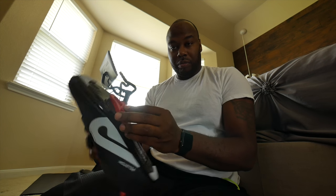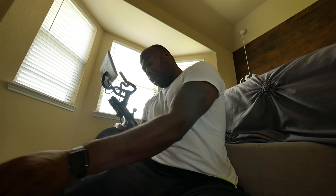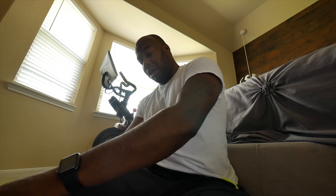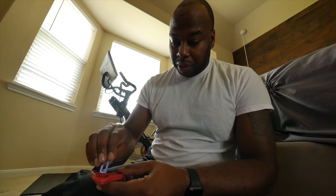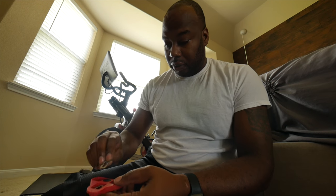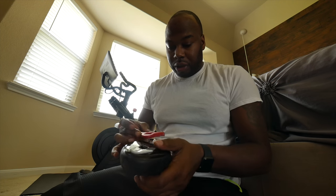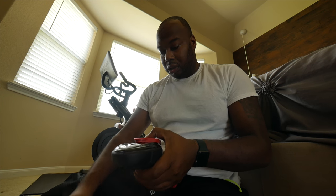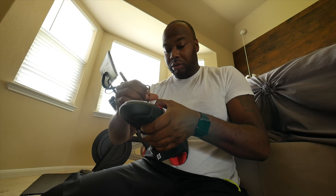So, this is the actual part where it connects to the shoe. My wife had other cycling shoes and she paid for somebody to do this. I'm not paying nobody to do nothing because I'm cheap — but then you're going to say, well, you got a $2,000 cycling bike. These little rectangle things go inside, just like that. Self-explanatory. They fit in just like that, guys. Then you just sit it down, put the little bolt thing in there, and do about two or three turns to get it into the actual groove before tightening it down, because you can center it the way you want.